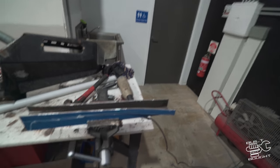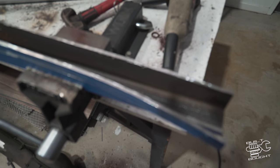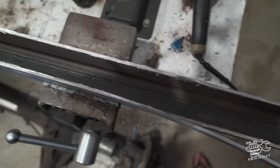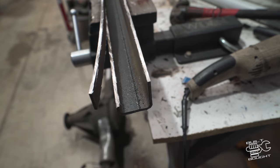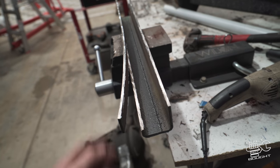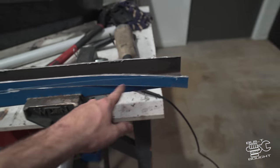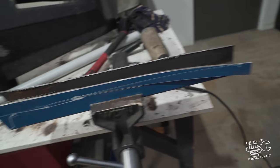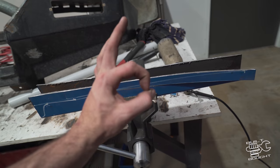Here's an example of how heat will affect the warping of metal. This isn't even welding — this is purely grinding — and you can see how much it's warped just from the heat of the grinder. It just goes to show that heat plays a massive role when it comes to torsion and tension in metal. We don't want that to happen to our diff, so it's all about keeping things rigid and tacking along the way so stuff like that doesn't happen.